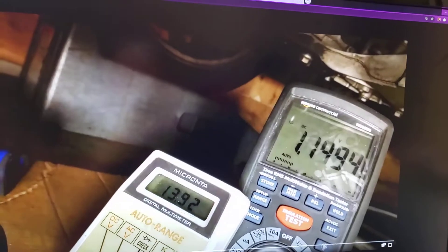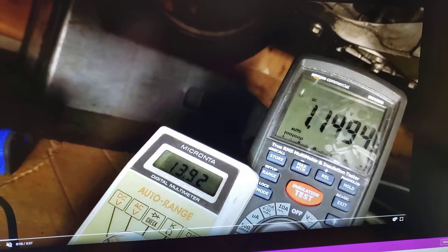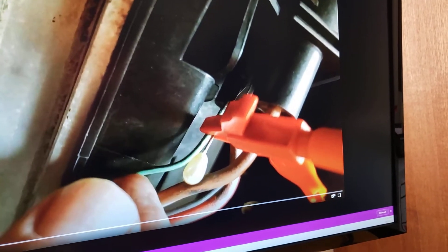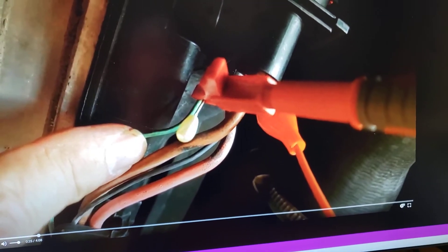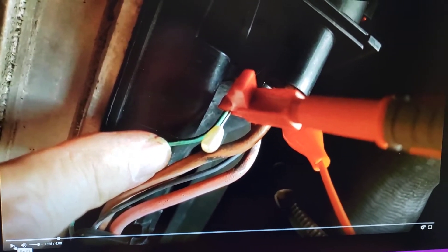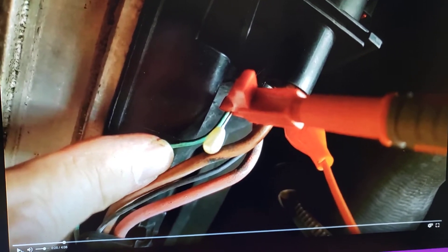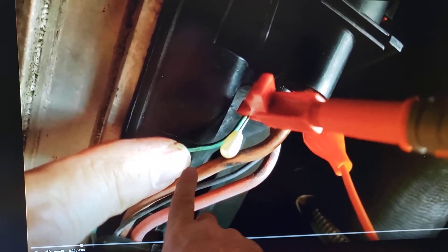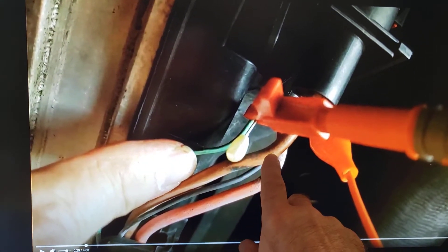I think it's actually safer to test the voltage than testing continuity, because if you were to test continuity, understand that the big red wire on the connector always has voltage — even when you turn the car off, there's strong voltage. So I'd be careful doing any continuity testing even when the car is turned off, unless you actually disconnect the battery. This other big wire — red wire with black stripes — is ground.